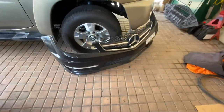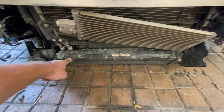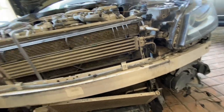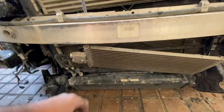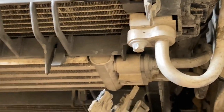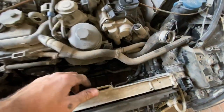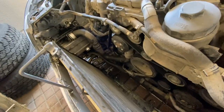In the end it is easier to take off the front bumper so that you can remove what I believe is the transmission cooler, the oil cooler, the power steering cooler, and the condenser. Those are mostly held in by plastic clips which you just lever out forward. The oil cooler had two bolts on the side that you had to take out so you can drop it and slide it out, separating it from the radiator. Then there was one very annoying 8mm bolt holding the AC line and power steering cooler line. After fighting for at least half an hour with no space whatsoever and a lot of wiggling back and forth, finally she's out.